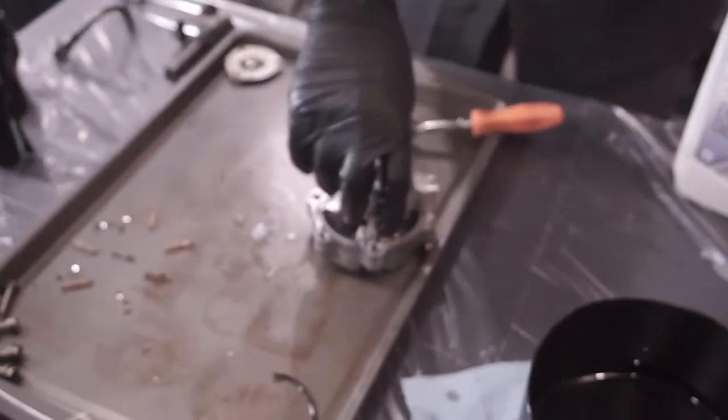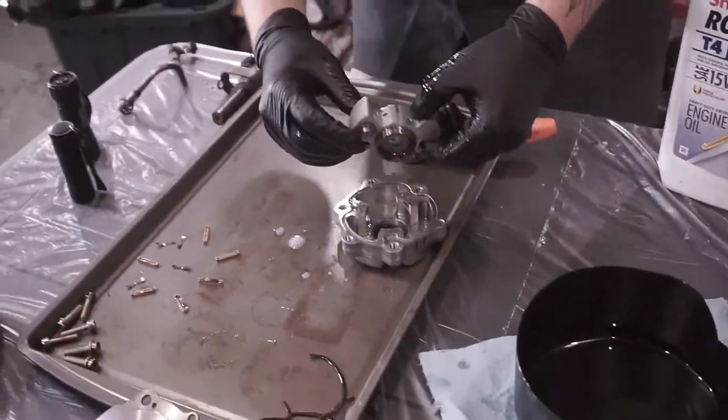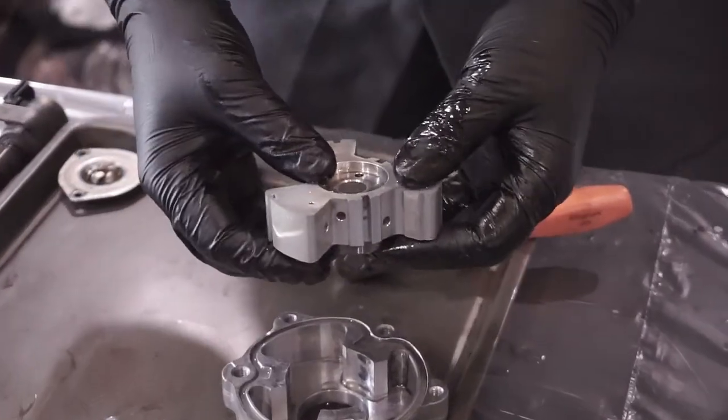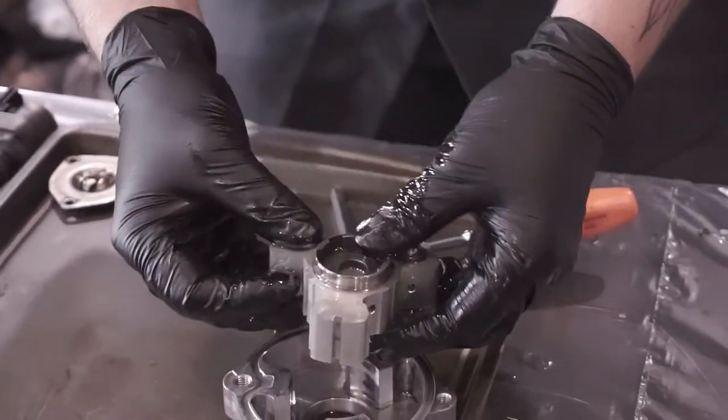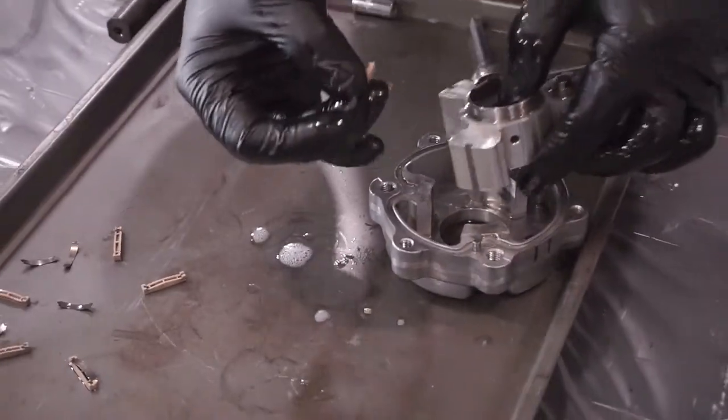So that kind of gold flake that we're getting in there, that's actually bearing material. So flushing out your rotor, basically all the pieces of this system, is a really good idea. If you're getting that much material in there, that means that would probably stay in the system for a while. All right, and next step is that we're gonna start assembling all of these little pieces.